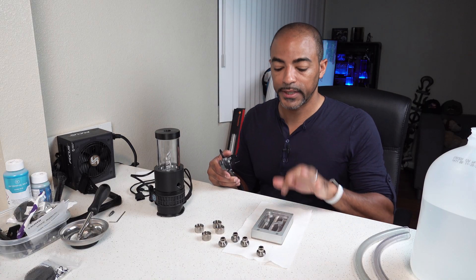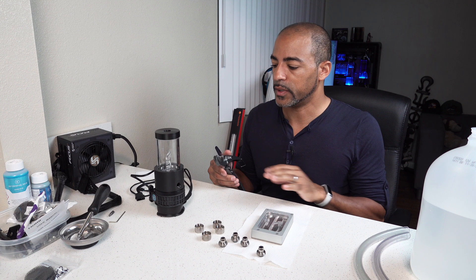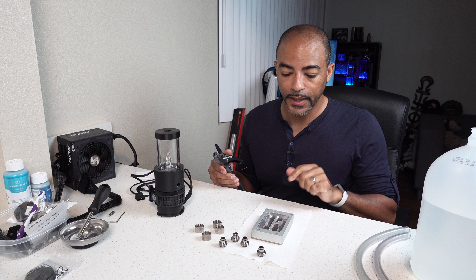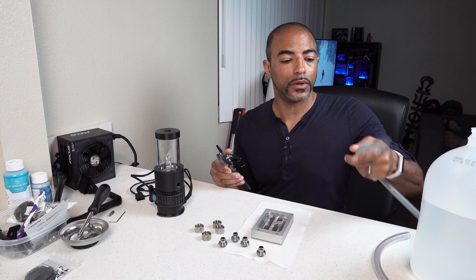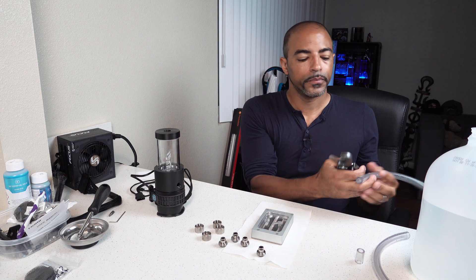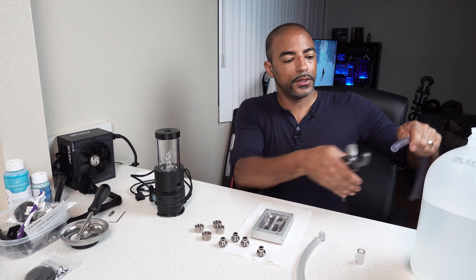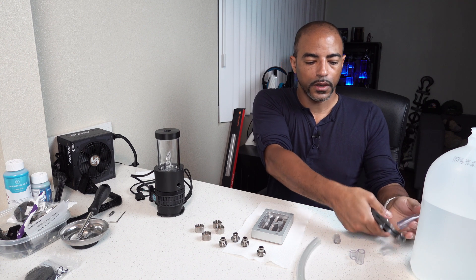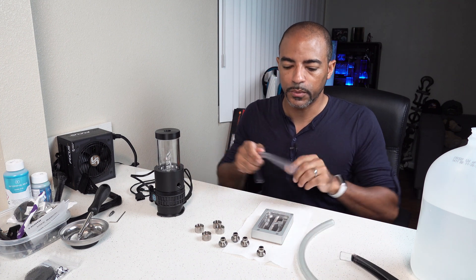We're at the responsible stage of testing this for leaks. If you didn't see my previous video, this is an EKWB D5 pump. I tested it for leaks in that video and it ran perfectly. We want to make sure, especially since we took it apart, that there are no leaks whatsoever. I have some older soft tubing here - I'm going to have to cut some of the ends just to freshen them up - and we're going to do a quick, simple loop. I did rinse these with tap water and then flushed with distilled water, so we don't want any unnecessary dust or crud buildup in here.